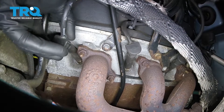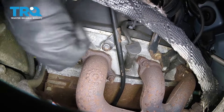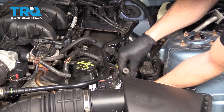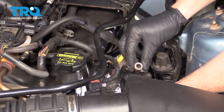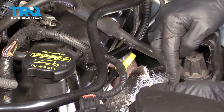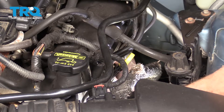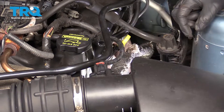Next I'm gonna grab onto this wire, give it a little twist — that's gonna break it free from the ceramic on the spark plug. Give it a little tug. That came off great. It's a good idea to take a peek inside the wire and make sure that you didn't rip it apart or anything. This looks good. If the boot looks damaged, corroded, ripped, torn — pretty much anything that makes you feel like it should be replaced, I would just definitely replace it at this time. It just comes right up here and connects onto the coil. If you do one, you're doing them all.